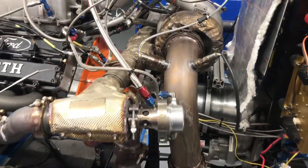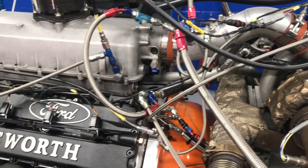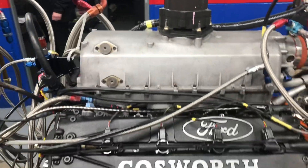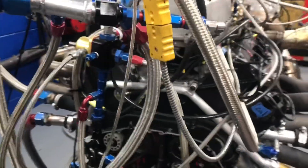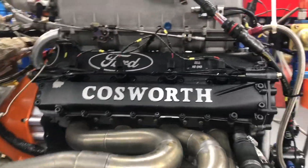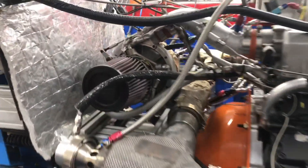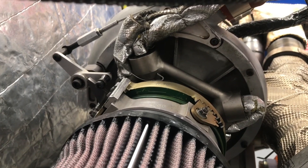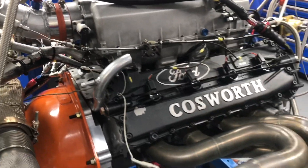You're probably asking why anyone would go to all this trouble to regulate manifold pressure on something that only makes seven pounds of boost. An interesting thing can happen on a turbocharged engine at part throttle: under the right conditions of throttle opening and rpm, enough energy hits the turbine that the turbo suddenly spools up. If a driver has his foot at a constant throttle position entering a corner expecting linear power delivery, the turbo spooling up gives him more power without requesting it - which makes them uneasy. That's why they went to all this trouble.